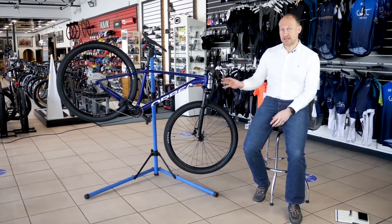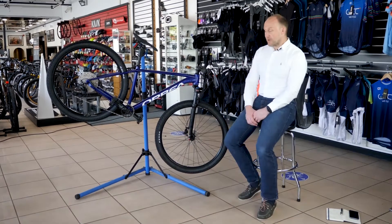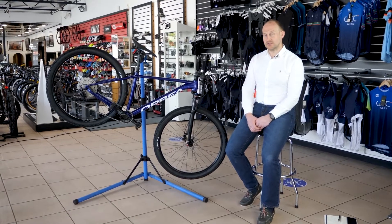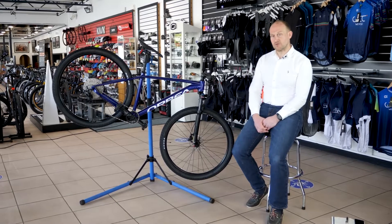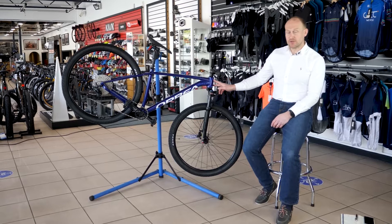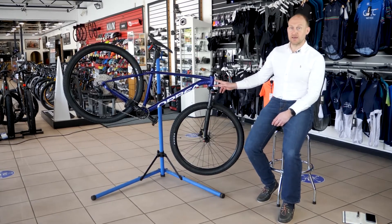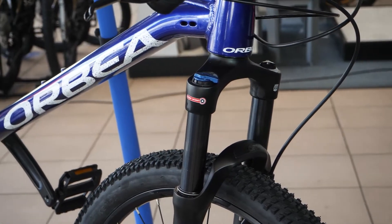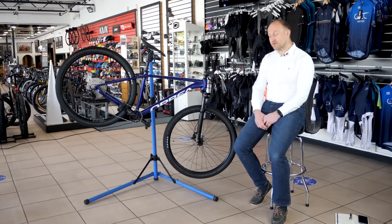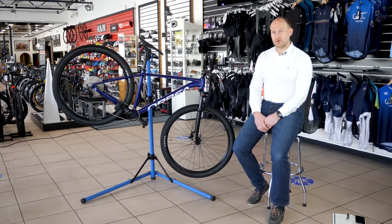All of them are based on the same aluminium frame, and that's where the beauty of the bike really is. Orbea have designed this with the idea of being able to personalise and upgrade parts as and when you're ready. With that in mind, they've gone for a tapered head tube on all the frames, which means you're able to take a much wider range of 100mm forks from a lot more companies, giving you the ability to upgrade or change depending on what you're after.